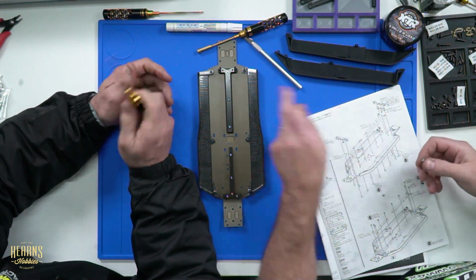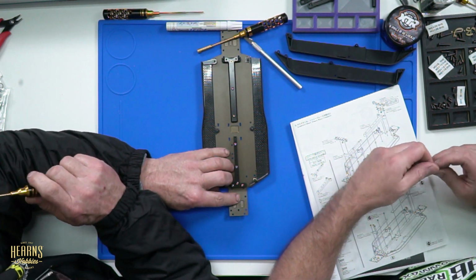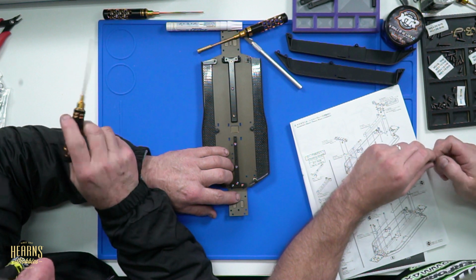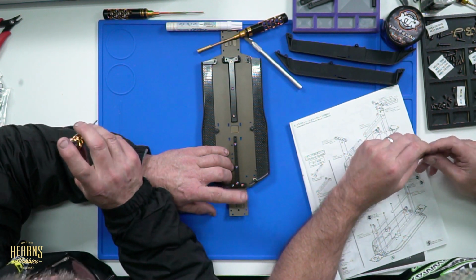So it's 10 degrees kick up in the front of the chassis. Yep. And standard it's 8 degrees on the caster blocks. Yes. Which is an 18 degree total caster kick up. We run 17. Really? Truly. You notice the 1 degree?